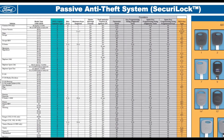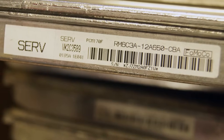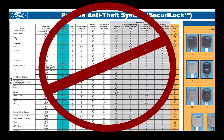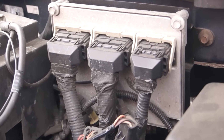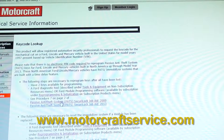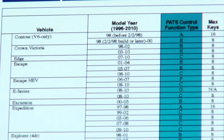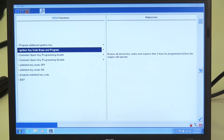If the vehicle is equipped with a PATS system, it will have to be set up after the replacement PCM has been programmed. If the replacement PCM has been programmed by the manufacturer, the programming would not include setting up the PATS system, so that setup must be performed with the replacement PCM on the vehicle. To identify the type of PATS system on the vehicle, check the Key Code Lookup section at www.motorcraftservice.com. Refer to the appropriate chart by vehicle and model year to determine the system requirements and follow the procedure for setup.